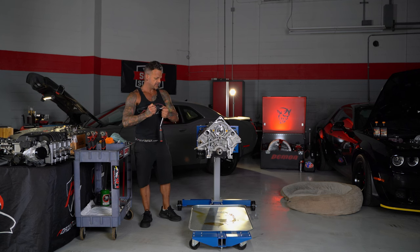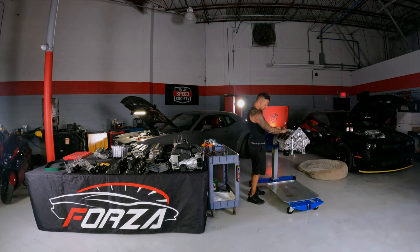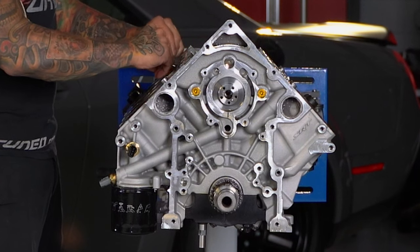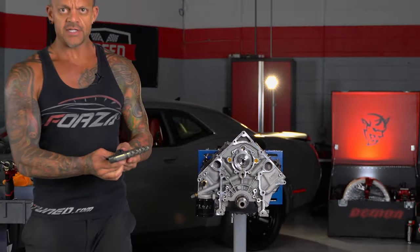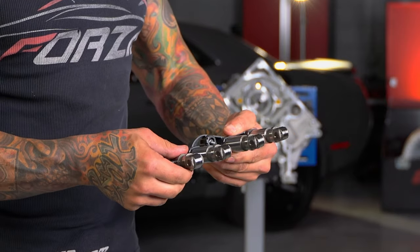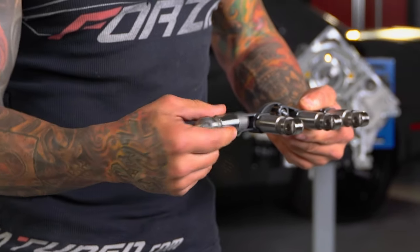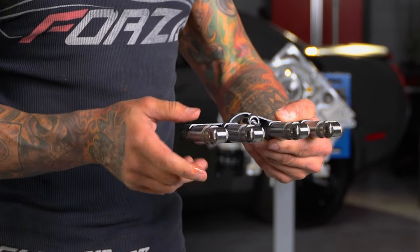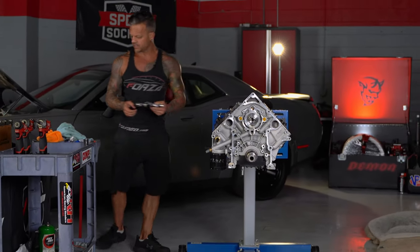On the lifters, it's going to be lifters and lifter trays — very similar design on all new engines. There are some plastic tabs that hold the bolt. You pull these out real easy and you can keep the lifters in them. These are called lifter trays. These are roller lifters, and what the tray does is retain the lifter and keep it orientated. If you look at the lifter, you'll see it's got a flat spot on each end, and this tray keeps it so the roller stays true running on the camshaft. We'll replace these with better lifters, but the stock ones are not bad.